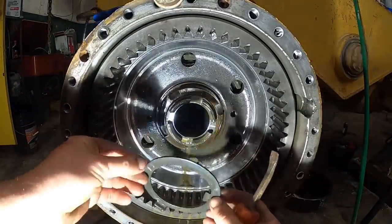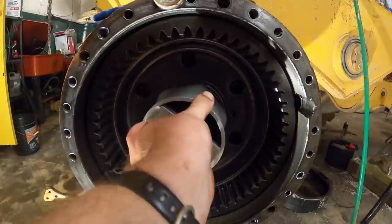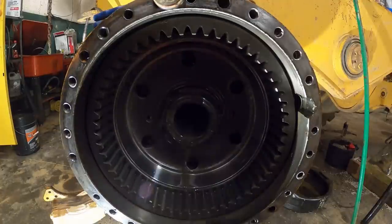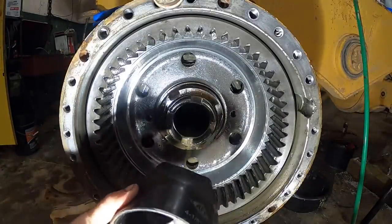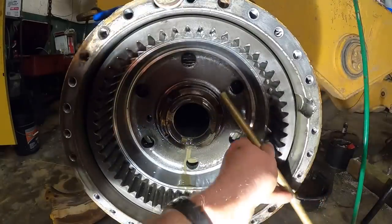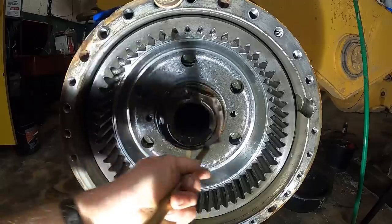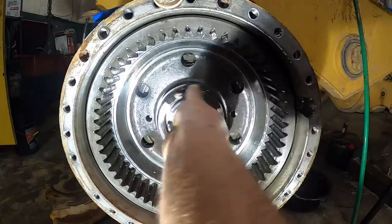Next is this locking washer — got it. And it looks like next is going to be that nut. When I was working on the Jeep, I had a subscriber send me some axle nuts, but this one here is just not quite going to fit on there — it's kind of double-sided, it's not a hex. So we're going to have to go the old-fashioned way on this one. Usually these things aren't real tight. The bearing actually feels pretty tight — I gave it a little jiggle before I started disassembling.